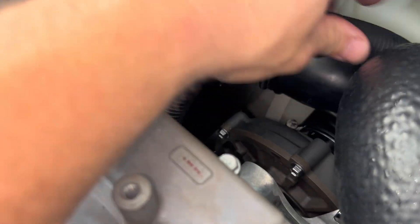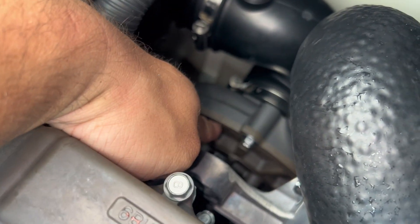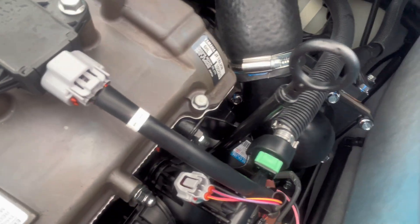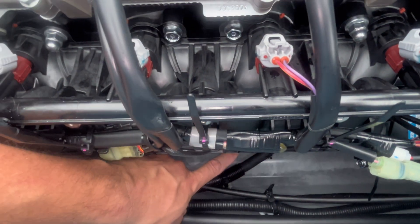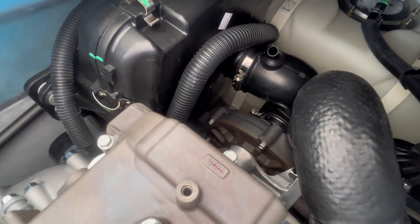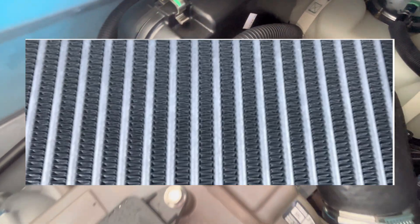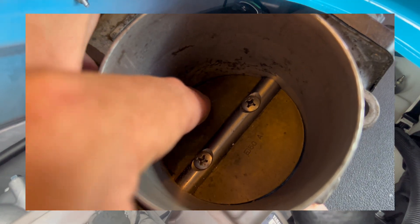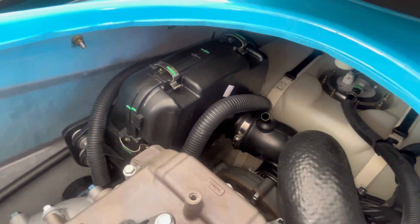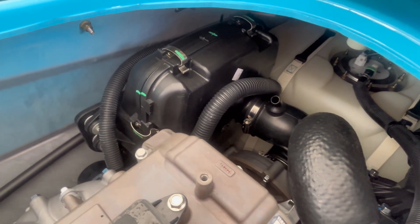When you spray that product in, it goes right into your intake, directly into the supercharger. It then goes through this duct to your intercooler, and then down into the throttle body, which is located right below the intake manifold. So all components within the supercharger, the fins in the intercooler, and the plates in the throttle body get lubricant on them. This atomized lubricant will not only protect the components from salt deposits, but from moisture and condensation that build up in the system when stored.